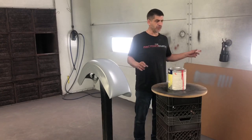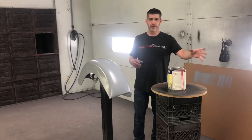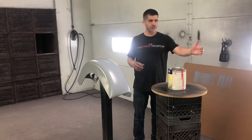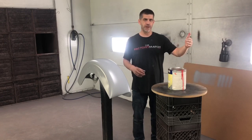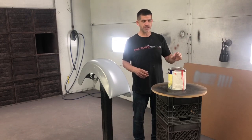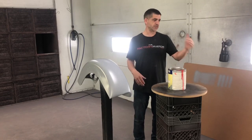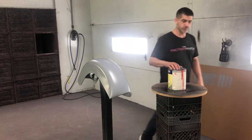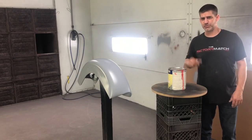So we'll get started with that, and you've noticed maybe that I don't run that very long, because if you do run that too long, that hose gets pretty warm from that turbine pushing that air out. So I try to minimize as much as possible of that running. I start it up, I paint, shut it off. We'll be back. We're going to let this flash probably for about another 5-10 minutes, and then we'll start base coating.